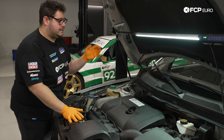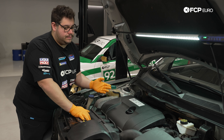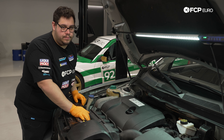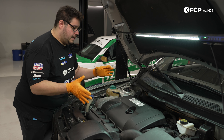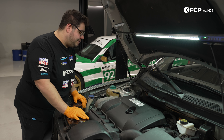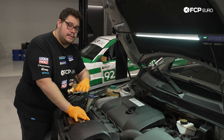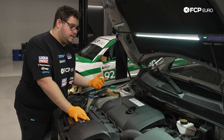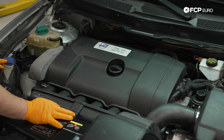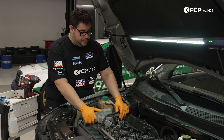Under the hood of the XC90, this is going to be a 'dancing around' type DIY — you have to remove one mount in order to access another. The engine is cradled on the subframe, which is why there are six mounts. We'll start by removing and undoing items on top, then switch underneath and come back up. First, take the beauty cover off if your vehicle still has it.